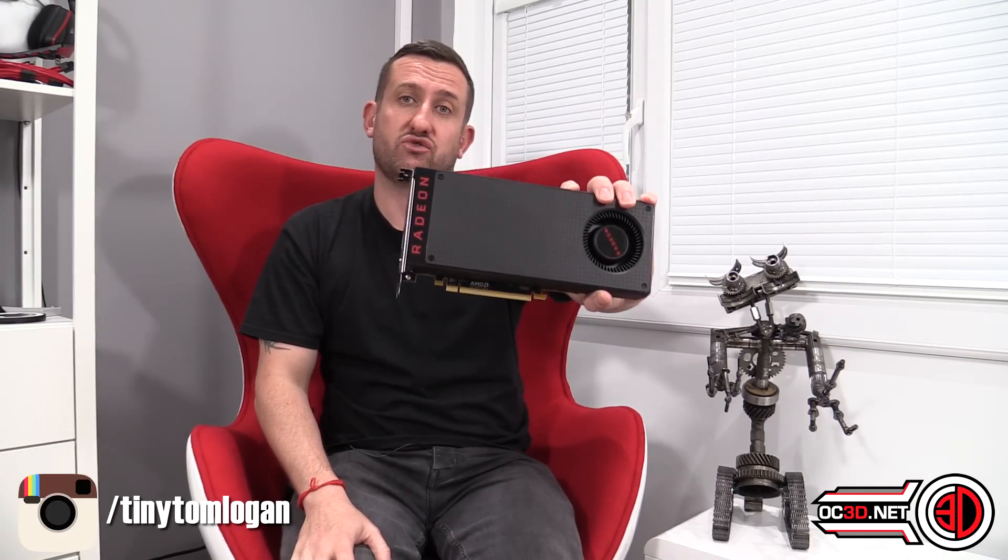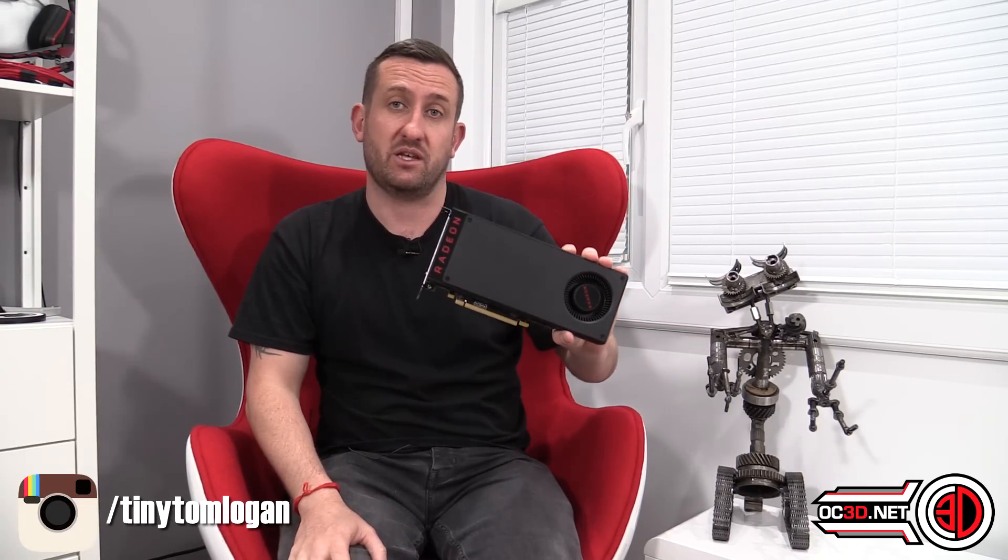I just wanted to let you know this is not a video I've done lightly - I've spoken to a lot of people today. I'm just doing it to give you a heads up. So if you want to get the most performance from your RX 480, especially if you've got one of these reference ones, don't worry about the megahertz - it's all about the power target. As soon as you touch that power target, the most critical thing is you're going to have to ramp the fans up as well. And with that, I now understand why EK have got a water block out.